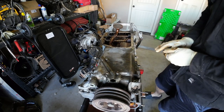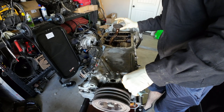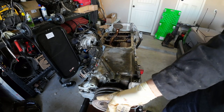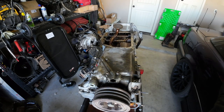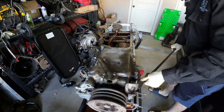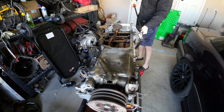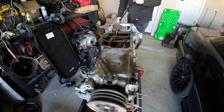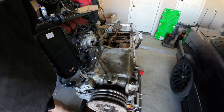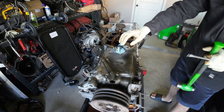There are some pry areas that Toyota graciously left for us. I'm going to go really slow because I'm not sure how this pickup comes off and whether it's still attached to the oil pump somewhere. I might have to take that front cover off for the oil pump first. Some exploratory surgery. I'm still planning on reusing this oil pan so I'd like to not destroy it. According to the FSM it actually does say to use a screwdriver — who knew. There are specific spots where the screwdriver goes in.